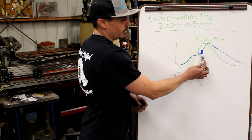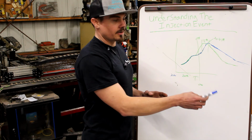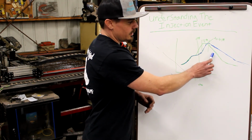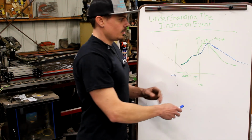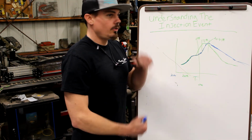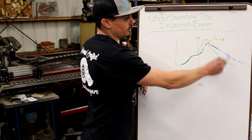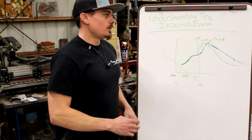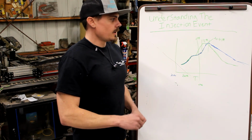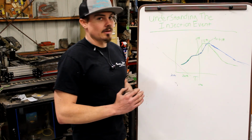Whereas if you go to a smaller injector or add timing, when operating at the RPM that the timing works appropriately at, a lot of the power stroke can actually be used to pull on the gas front itself. And when you pull on the gas front, instead of compress it, we cool that down. And by the time the exhaust valve opens, we see a lower EGT on our EGT probe. That was actually probably a pretty important little piece right there. I think that'll help a lot of people understand tuning and what's happening inside the diesel engine itself.